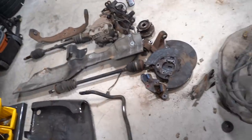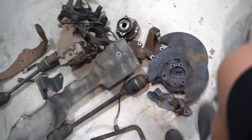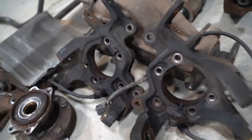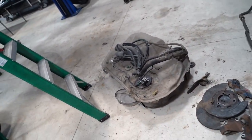Our freaking pile of parts just keeps growing. I think I want to spend the day cleaning up a ton of stuff that needs to be powder coated. I'm not going to touch the CV axles or the rear diff yet because we don't have parts in to get all that stuff rebuilt, but everything else we can definitely work on. We have to press these guys apart - they're going to get some new bearings and seals. I was going to get a whole new assembly but the bearing was $20 versus like $100 or $200 for the assembly, so save some money there. We've got to try and get those ABS sensors out, we have some bushings in that mustache bar, and the diff mount bushings are going to come out as well. Let's start getting everything disassembled with our new Harbor Freight press, and I should probably put this gas tank somewhere because it's taking up all the space.